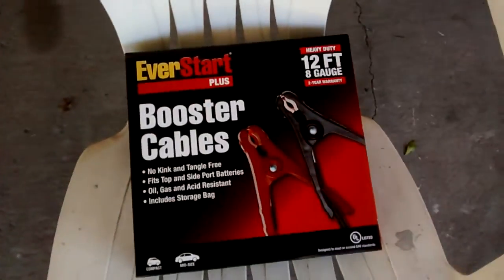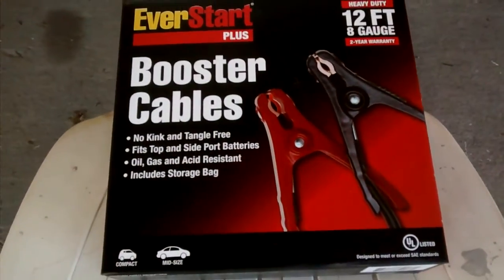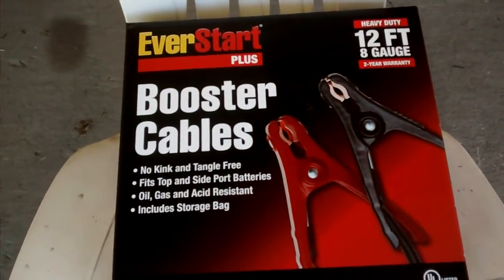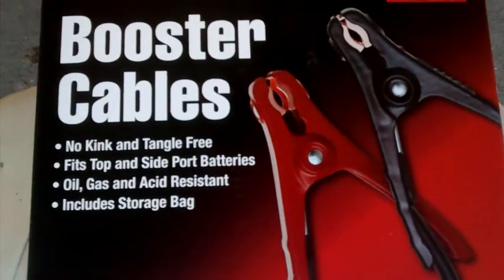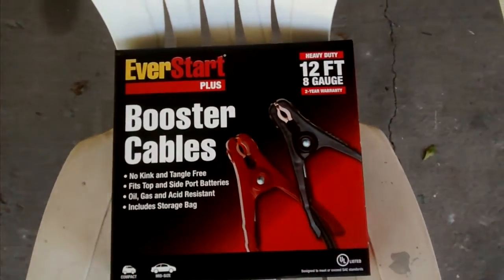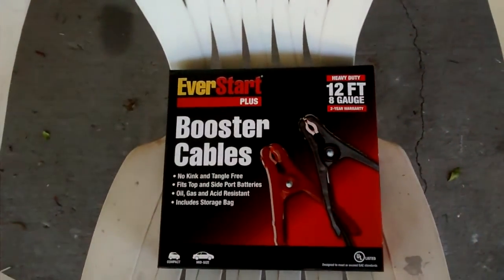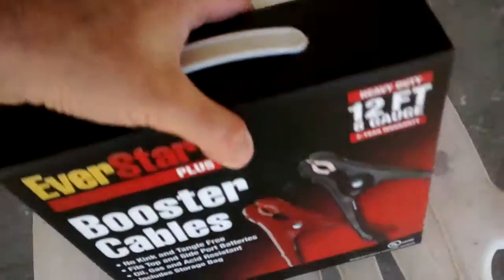As mentioned in my previous video about my air compressor, I want to replace the cables. The wire is pretty thin — only 18 gauge, which in metric translates to about 1.02 millimeters. I'm upgrading to this 8 gauge jumper cable wire, which will better bring the voltage from the battery to the compressor. With longer cables, voltage tends to drop, so this will carry the current better.